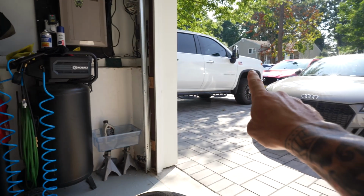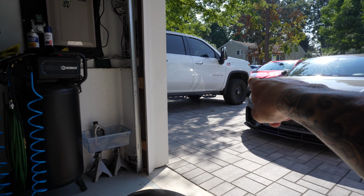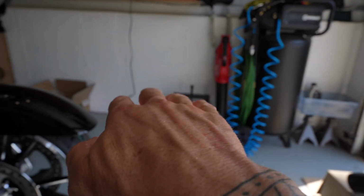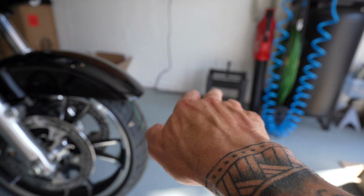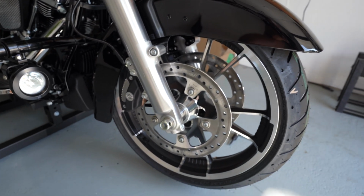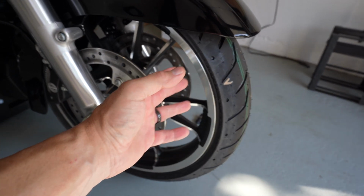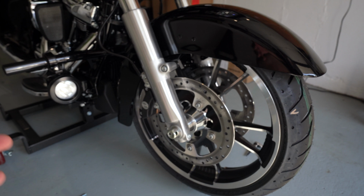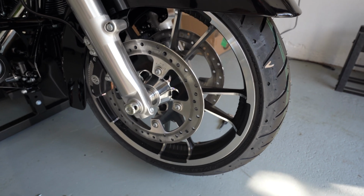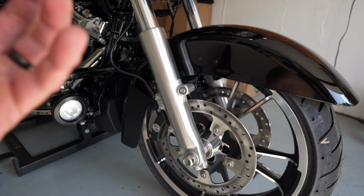I'll give you a great example: my 2500 diesel pickup truck. I put big 33-inch tires and wheels on it. Being that they are bigger and heavier, on a turn, if it hits a bunch of bumps, the truck actually starts skipping. That's because the suspension cannot keep those front wheels and tires on the ground fast enough. You can go lighter wheel, you can go carbon wheel, which I don't know, maybe I will, maybe I won't. But for right now, we are keeping these wheels, but we're trying to lighten up the load that the suspension has to work.